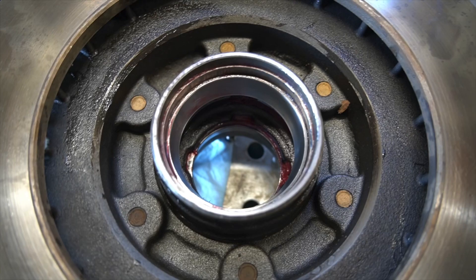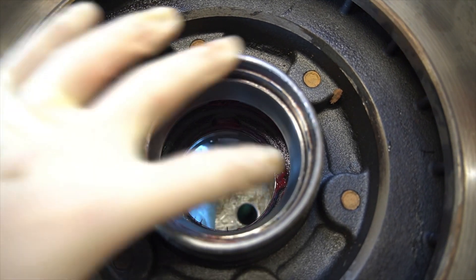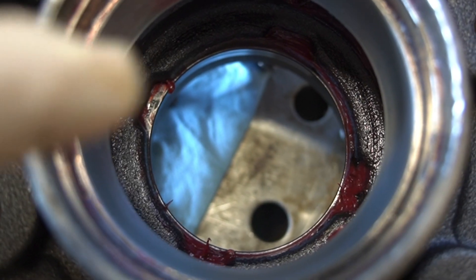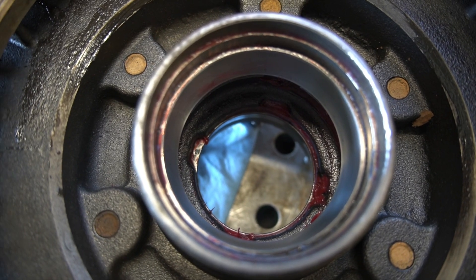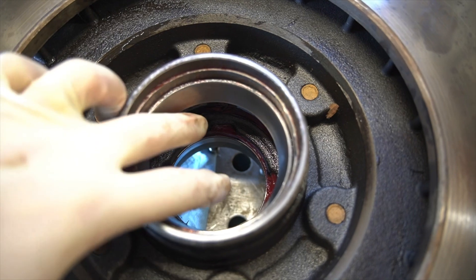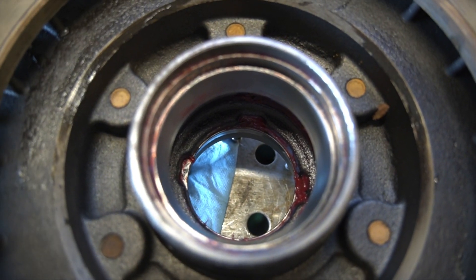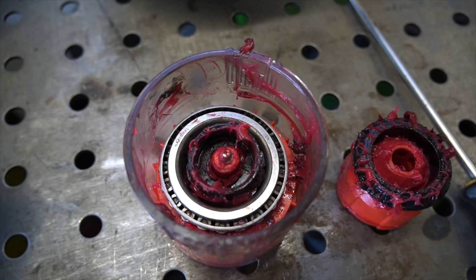With our cavity all cleaned out, let's look at our races. I did the bearings up front previously, so these races are actually new. Check these surfaces for any pitting or scarring — if you do have to replace them, there are four little points down in the bottom; use a long brass punch and work your way around to punch the races out, then drive them in from the other side. What we're going to do is pack this cavity with grease — a wall of grease even with the edge of the bearings. Then clean up and pack our actual bearings with grease. We've got our cavity all full of grease and our race covered. Now the inner bearing is cleaned up with brake clean and sitting in our bearing packer.